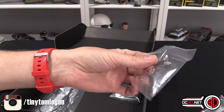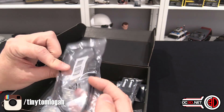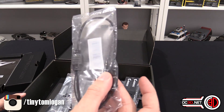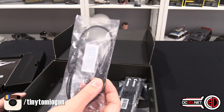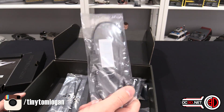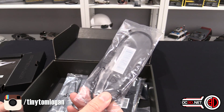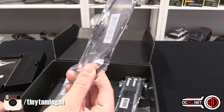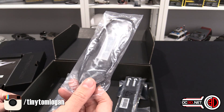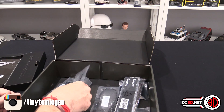The screws are going to be for your M.2s, there's an SLI bridge, and there is an RGBW extender — it's RGBW so it has a fifth pin. You can still use it with normal RGB cables, but with the dedicated white channel you can get RGBW and RGB UV cables. Cable Mod do make them, meaning you can have a dedicated white or a dedicated UV — you normally have UV or white on the extra channel.